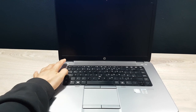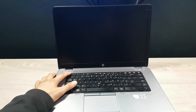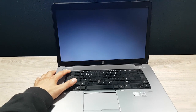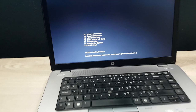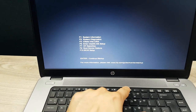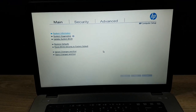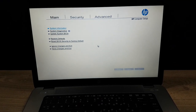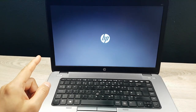Step 6: boot into BIOS or UEFI and note down details like the hard drive, processor, and RAM. Also make sure there's no BIOS password set. If the seller doesn't have the BIOS password, just leave it alone — unless you're tech-savvy enough to bypass it.